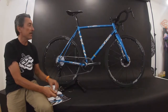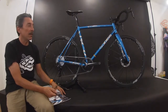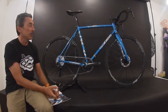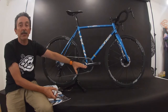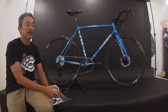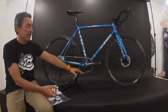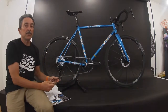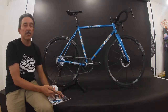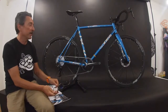An important thing to underline is the geometry of this frame — it's a criterium geometry, which comes from the years of experience of our channel team fixed gear riders during races, particularly Red Hook. The geometry features a bottom bracket 20 millimeters higher from the ground compared to a standard road frame. This allows you to keep pedaling even during fast turns in a crit race, so you don't touch the pedal on the ground and can keep pushing while turning.